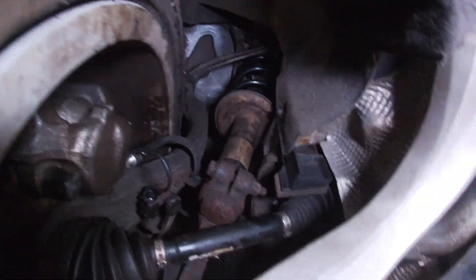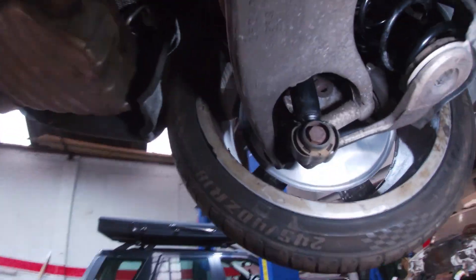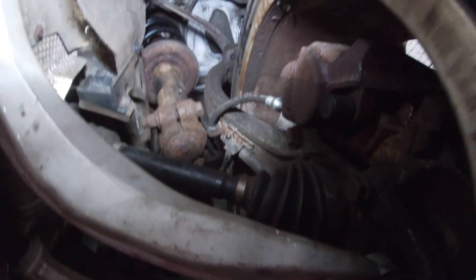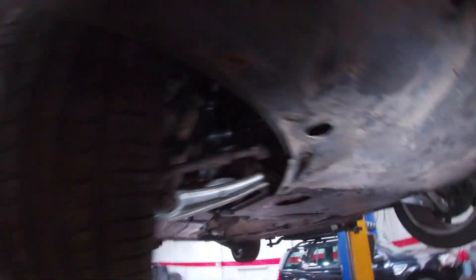I'm not happy with how the car's sitting, so I'm glad the sticker's still on the shocks — I've still got the weight on them. The sticker's still on it because I'm not happy with the car when the weight's on it. I've put these Munroes on the back, and I think they're KYB springs. I may take them back off again. I know the front springs are right because I matched that one up. I didn't really have a choice with the back ones — I don't think one of them was already changed before I touched it. Also we had a drama with the sump — the sump bolt had been cross-threaded.